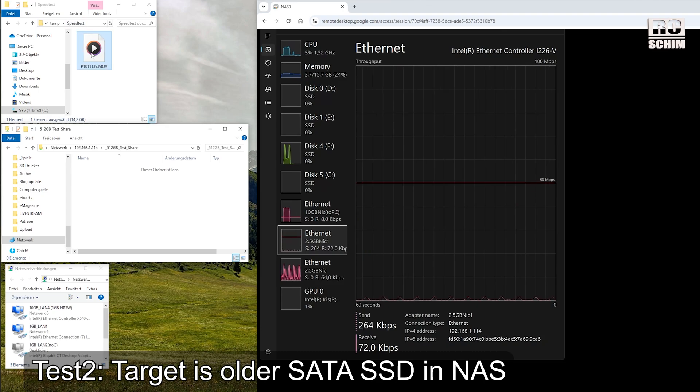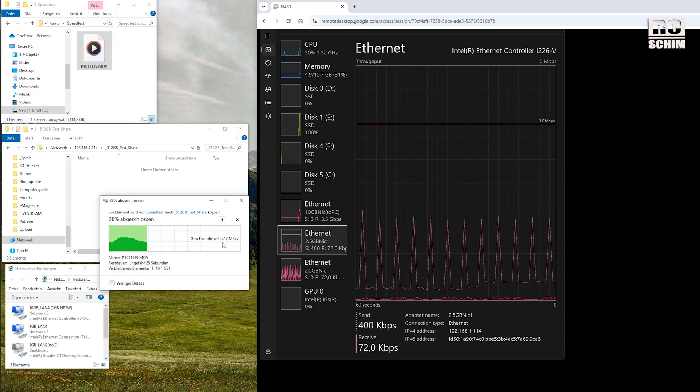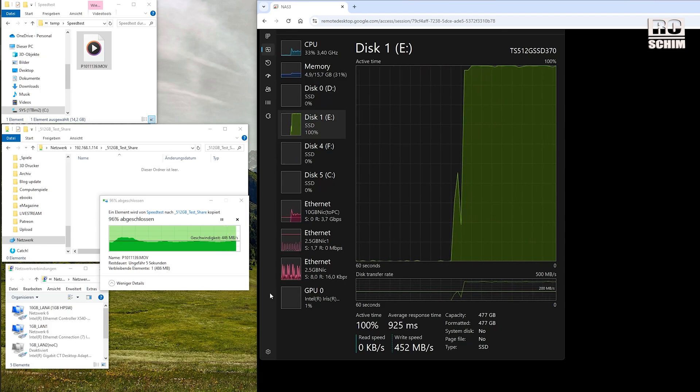Those tests were from my fast system drive on the PC, over 10 GB, to the fast NVMe drive in the NAS. With a really old SATA SSD, to reach the SATA limit, it gets 400 or 500 MB/s — 100% saturated. So in that test we're reaching the limit of the SATA SSD, and in the other test we're reaching the limit of the network card.